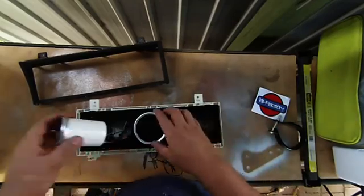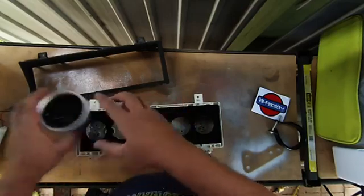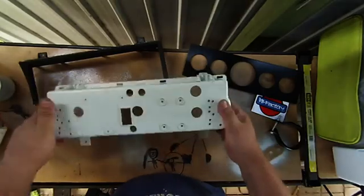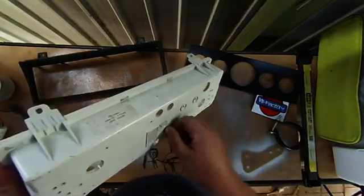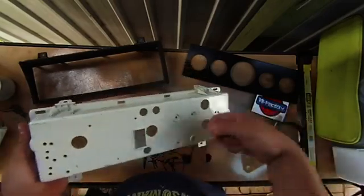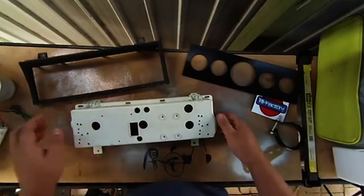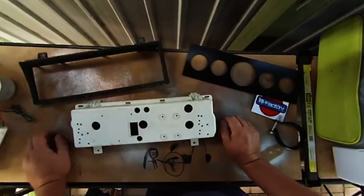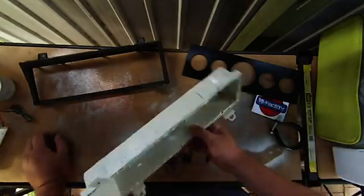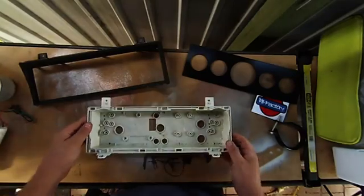So now that we've got this far, we just got to cut the back of the panel off. Just bang that off with a grinder and a cutting wheel. It'll also make it easier to get access to all the wires. Gonna try and put a plug on the back, just so I can do a male and female plug, so I can pretty much, like a factory cluster, plug all the gauges in one hit, and then pull them all apart in one hit for when I have to problem solve the car, because R31s always have lots of problems. But we'll get the grinder out, we'll lock this off, and we'll see how we go.